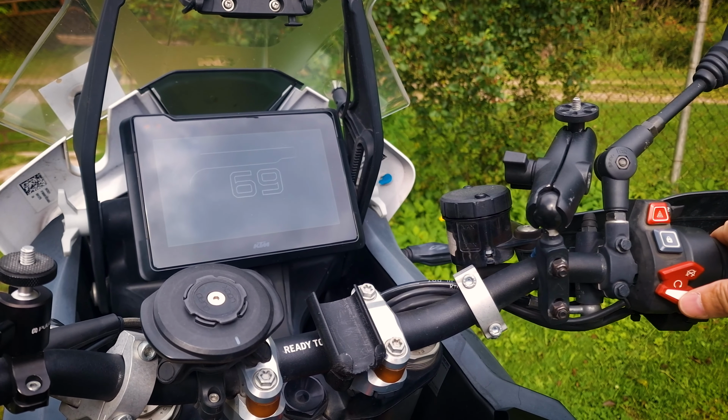It's a new day! We're still taking the bike apart, because it's clear now that the sensor is really damaged. Something has happened to it. We need to take this whole thing apart and remove the engine cover. It's not a lot of work, just remove the oil filler neck, unscrew some bolts that hold the cover on, unscrew the clutch actuator, unscrew the cover that covers the chain, remove a few wires, and that's it. Well, at least that's what I thought at the time.